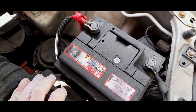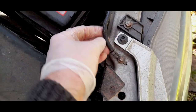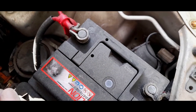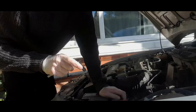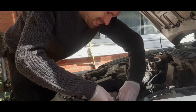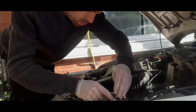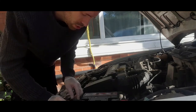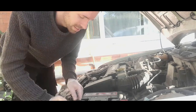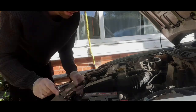Task number one: get this awful battery off. I'll disconnect here and there, and I might take the whole lead off and sort that out because I might need to clean up that earth point as well. First design fault is that the boot is in the way of the clamp bolt. I should do the negative one first — that would be wise. Negative off.